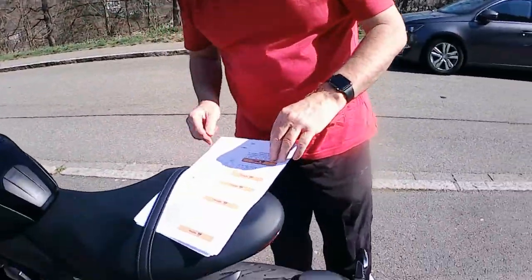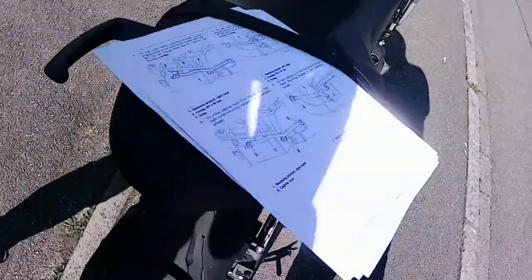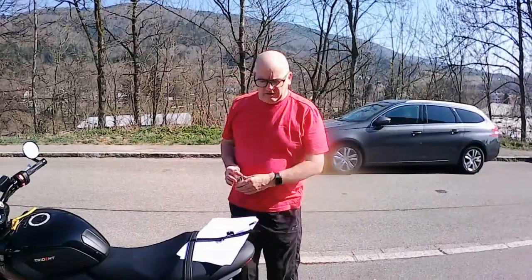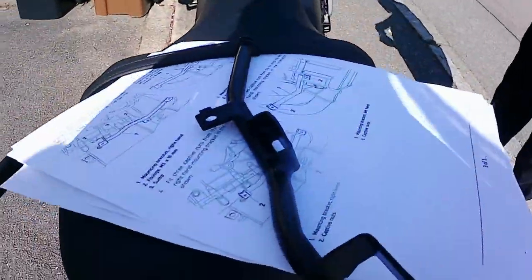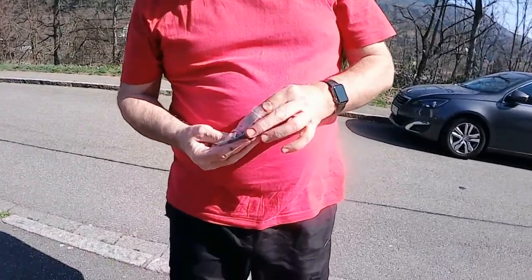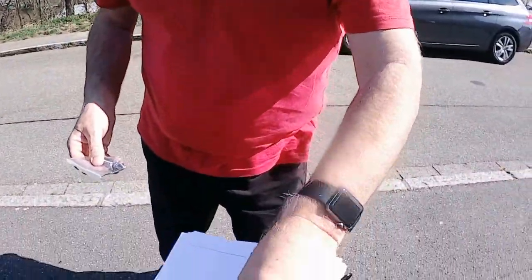So what's next? It says put a bung over there, but we haven't got a bloody bung. So, fitting the bar. So Triumph, in their wisdom, has all the fitting points already on the engine block, or sump. So, get these little bolts out. That's the longer ones. Should be four of them and five of the others. That's it. Right, so we want this.